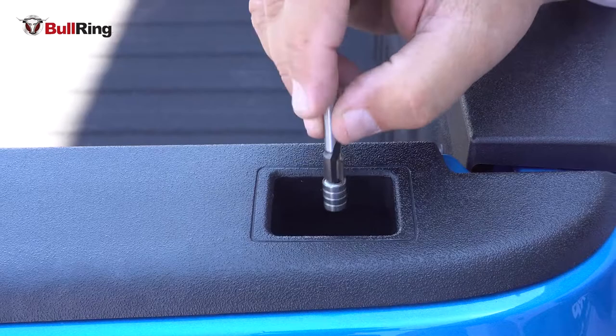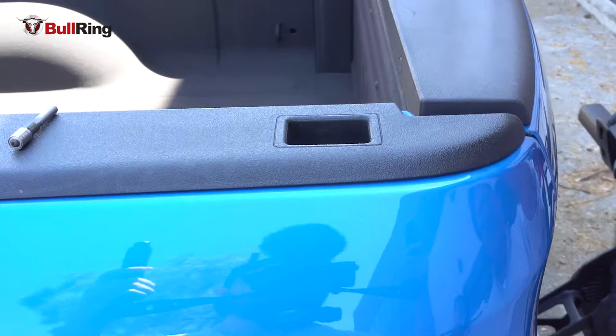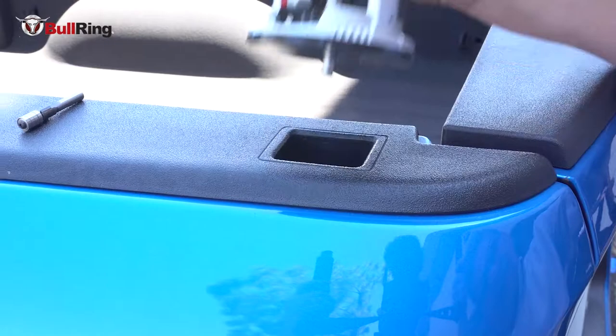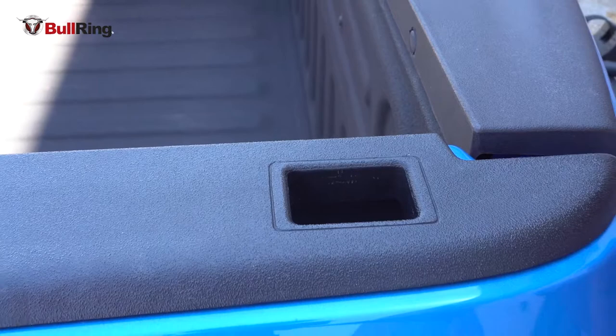What we're going to have to do is cut this plastic back here so that this finishing router bit can go beyond that and trim right up next to the edge of the metal. The first thing we're going to do is use our saw blade in the router. That will go in there and cut right below that lip, all the way around, and give this router bit an opportunity to clean the hole. This downturn lip of steel back here is probably about a quarter inch, maybe a little more, on the left and right side. I want to get below that, but I also want to cut close to it.